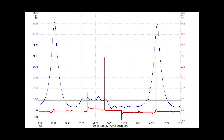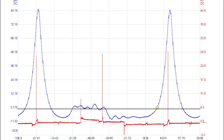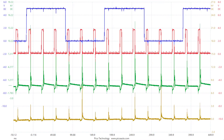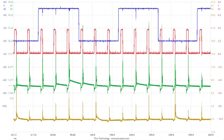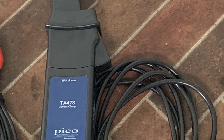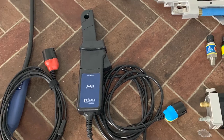Checking a vehicle's ignition timing — important on today's vehicles that are no longer equipped with timing marks — can be done with a scope. Troubleshooting misfires by interpreting the ignition waveform can be done with a scope. Inspecting the operation of fuel injectors both electrically and mechanically can be done with a scope. You can even perform a compression test of sorts with just a basic scope. But the real power is unlocked when you invest in certain accessories.